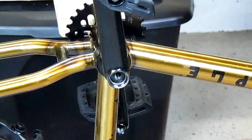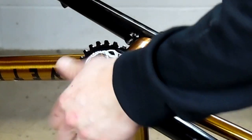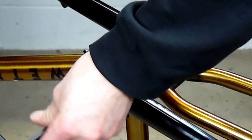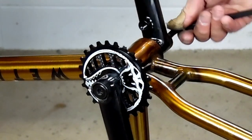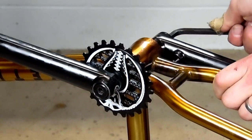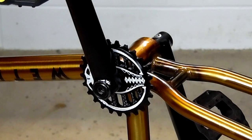Lastly, we'll put in our crank bolts. Just like the sprocket bolt, if it's something you take on and off a lot and you wear that thread lock off, I use a little Loctite on it — the blue, which is a medium lighter Loctite. I used red once and I had to sell that crank with that frame. Then after you get the crank bolts tight, we're going to tighten up our sprocket bolt that we just made slightly snug earlier. Carefully, so you don't crack your knuckles on the sprocket — I've done that before.